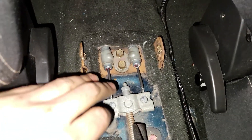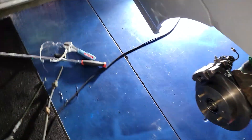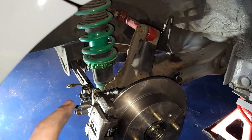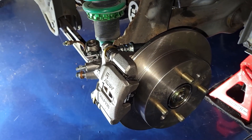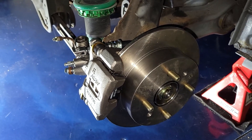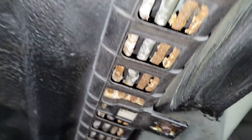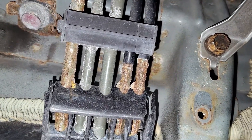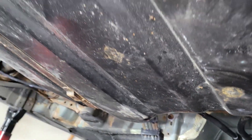Looking inside the car, I didn't really have to adjust these at all — I put that bracket back on and the ends slid right into the bracket, so we're looking good. Now all I really have to do to finish the job is get the new brake lines in to connect from here to the banjo bolt on the caliper. I'm still waiting for those in the mail — I ordered some Chase Bays lines, specialty lines. While I was underneath the car there was a lot more rust than I was expecting. Looking at the lines inside the track, I'm not very happy with that — some of those are fuel lines, and having my brake lines look like that is just not the safest thing. So while I have this all stripped down, I might as well go ahead and take care of those lines as well, just to be safe.